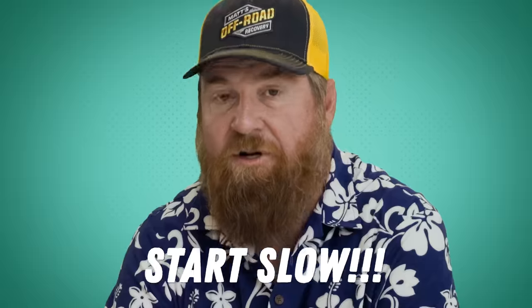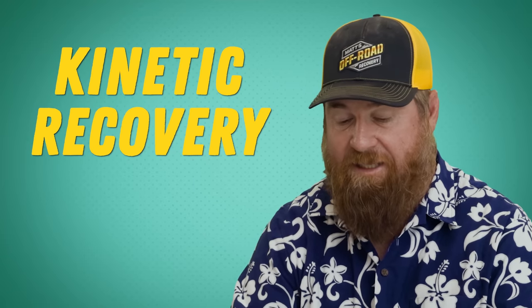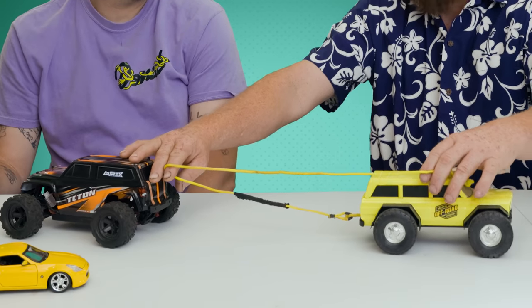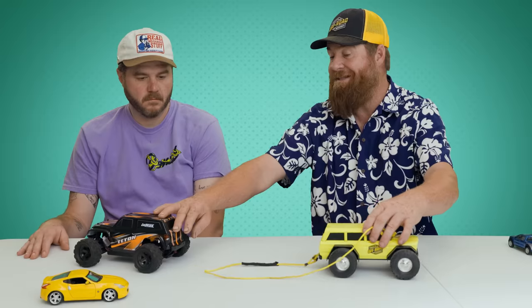All right, Matt, what are some basic tips that you can give to our viewers during their own recoveries? Number one, slow down. Think about it. If you're ready to do a kinetic recovery, start slow. What is a kinetic recovery? A kinetic recovery would be with a dynamic rope, like a mass recovery rope, yankum rope, something like that. Say this guy is really, really stuck. The first one might not get him out, but everything's okay. You haven't broke anything, you haven't killed anybody, it's okay. And just keep doing a little bit more, and then assess the situation.